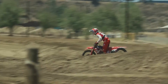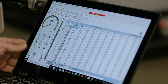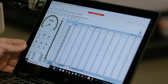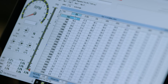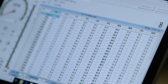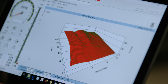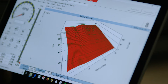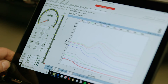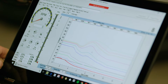This is where we start with our maps. This is the Vortex software and right now we're looking at a fuel map. You see a lot of numbers in here and these are all fuel values. Just with this fuel map alone, there are 640 data points that we can adjust or tune. So when everybody talks about maps, this is what it is and this is why they call them maps — it really does look like a map. Every throttle position and RPM point has a data point between them, and these are the areas that we are adjusting.